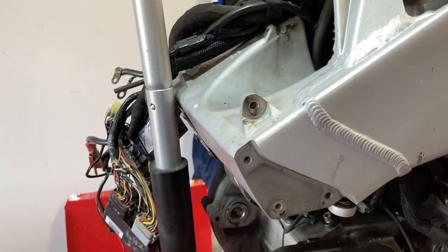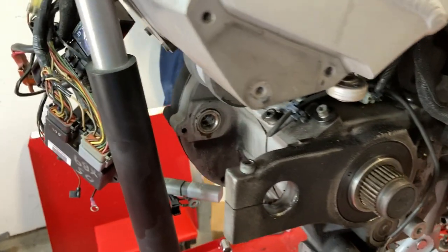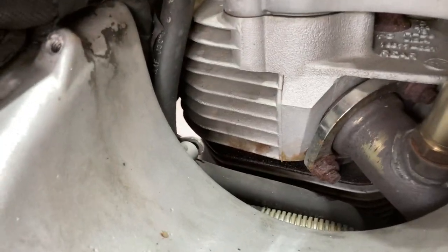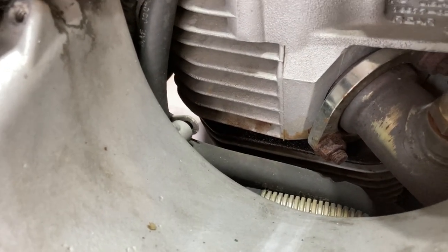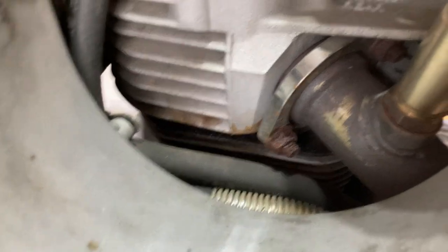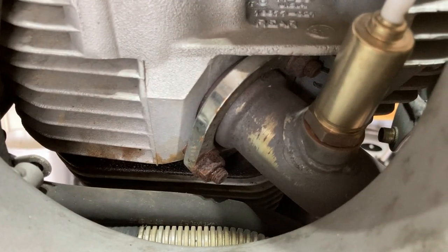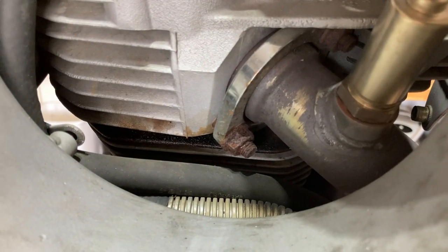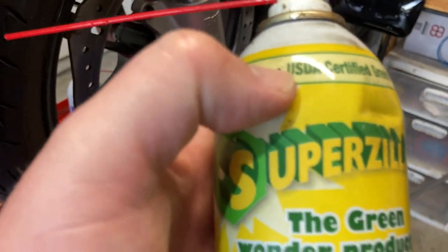This mess in my garage is getting bigger and bigger. Always remember to put the jack handle up so you don't trip on it — that's a pro tip for you today. I've got the fan removed, and hopefully you can see that that's an oil leak. Those two studs are going to be really fun — I'm going to have to soak those down quite a bit with some penetrant. My dad hooked me up with this stuff — let me show you really quick.